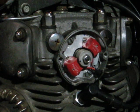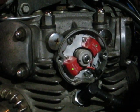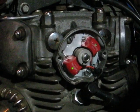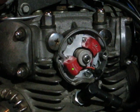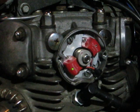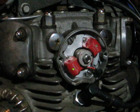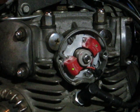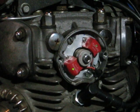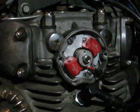Turn the ignition back on. Okay, and now there's a chance to check this one again. Lights out. Coming around. There's my full advance mark. I'm going to watch this sensor. Turning the rotor, stopping right when the light came on. That's not bad. It's on the advanced side of the firebox, the 2 lines with the F in it.